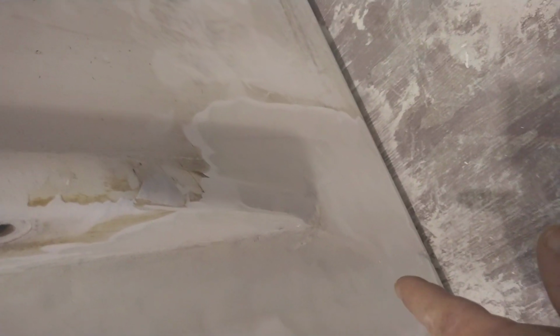And then this one's also got some structural issue, essentially, because these are where it's bolted on to the truck, and it had a series of cracks all along here and here. So I'm going to go ahead and lay a good couple of layers on there, probably like 5 to 6 layers in this one area, and semi-smooth it out. I'm going to leave it thick, so it's just got that extra support, and I'm pretty sure it will not crack again in these areas.